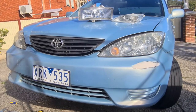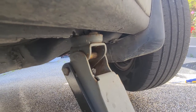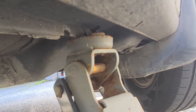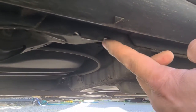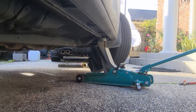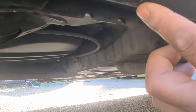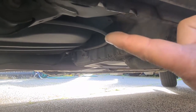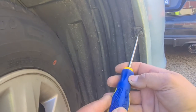Obviously you're going to need tools. The first thing I did was jack up the car to give more room to get under it. Here's the jacking point — notice the grooves and cutouts. At the back, there's a little arrow pointing to where you jack from, between these two cutouts. You can use the jack supplied with the car, or a 2.5-ton jack. You must jack from that center point — if you don't, you'll bend the chassis. That point is solid.